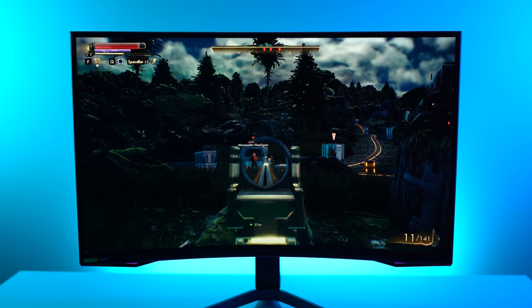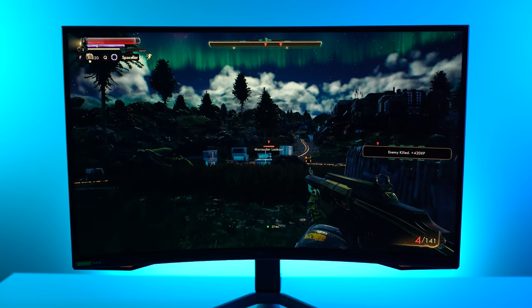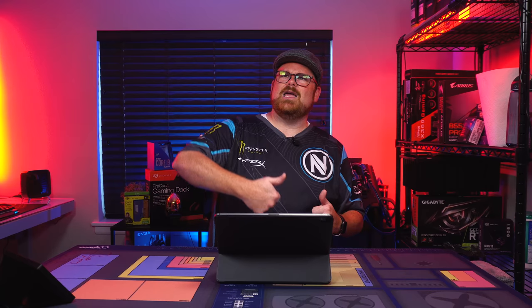This takes me to one of my main issues with this monitor: it seems that all of the additional stuff Samsung added is far from ideal. The sRGB mode doesn't even lock to sRGB. The black equalizer just makes everything very dark, and the way they implement it is counterintuitive — you turn it down to make the light go up. It makes everything really bright but super saturated, so colors don't come through. The short of it is Samsung did a good job calibrating out of the box, but all the other stuff — overdrive, MBR, and the on-screen display options in general — are weak, if not practically useless. Essentially, adaptive sync (G-Sync or FreeSync) and maybe some slight calibration to brightness and contrast are really all you need.